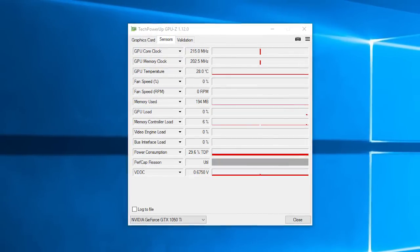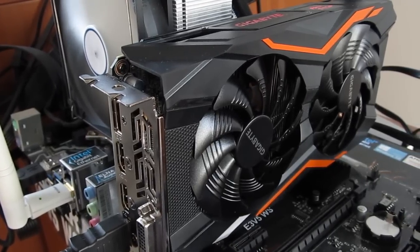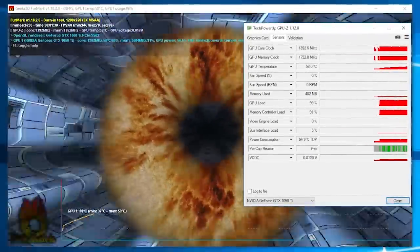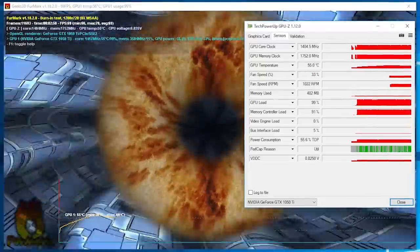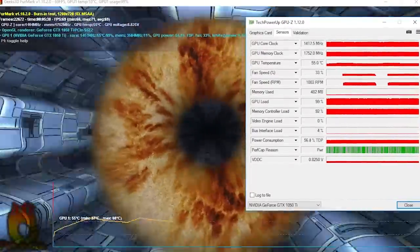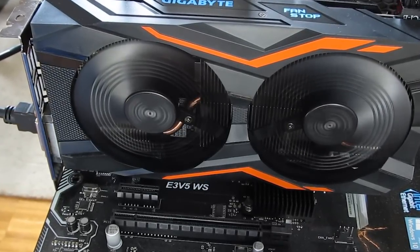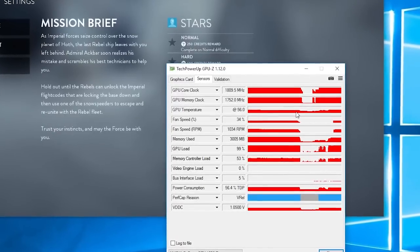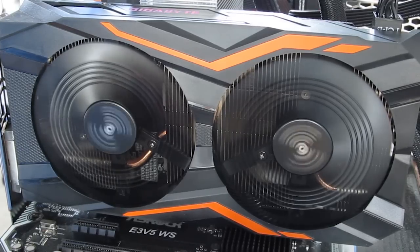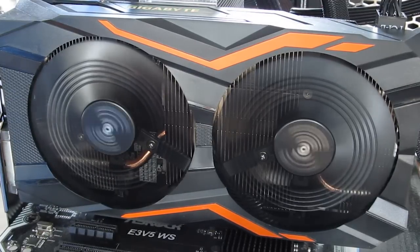Taking a look at temperatures, during idle you will see them being under 30 degrees Celsius — and that's with the fans turned off, as they don't spin unless the GPU reaches 60 degrees Celsius. Even under load they were not turning on for the most part. Looking at the temperature curve during FurMark stress testing, it would reach 60°C, fans would turn on for a minute or two at around 1000 RPM, lowering the temperature to about 55°C, then cut off again — cycling repeatedly. I saw the same behavior when gaming, with temperatures roaming between 55 and 60 degrees Celsius. Gigabyte has tuned up the fan profile since my previous experience with their 3D active fan feature, making that transition much more fluid and refined. Bottom line, the card is overall whisper quiet.